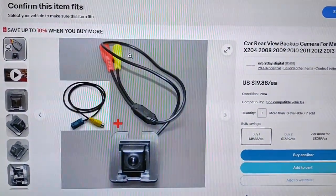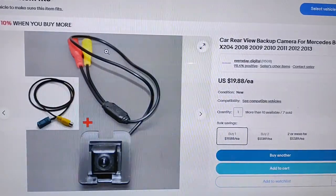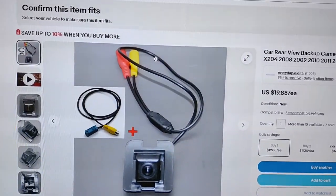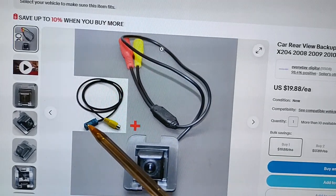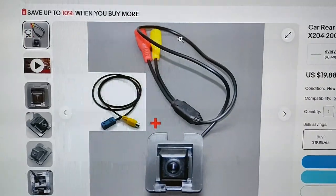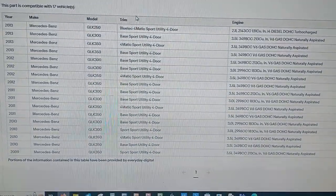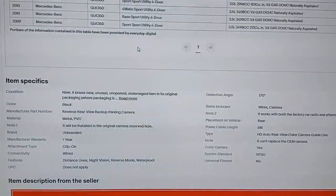I want to get away as cheap as I can doing this. I've actually heard similar cameras working out very well, so I'm going to take a chance. This unit does come with the FAKRA connector to an RCA female plug — that's important. You will need one of those to connect it to the back of your head unit. It's a very cheap camera, designed to work with my vehicle. I ordered it, waited a week and a half or so, and I'm ready to go.